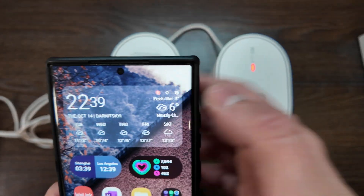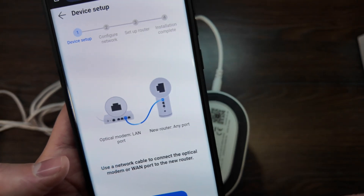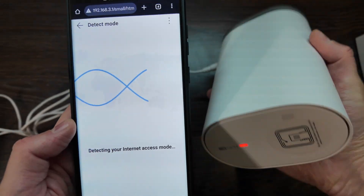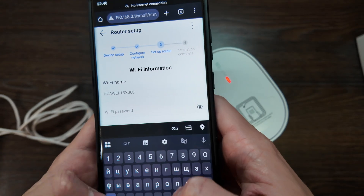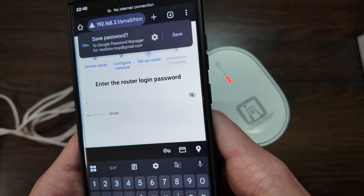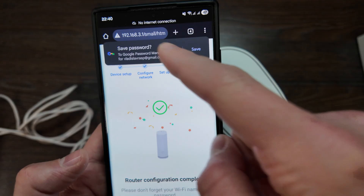Using the web address on my phone to complete setup. I'm connected — agree, allow automatic updates, get started. Selecting optical modem as a new router, connecting via network cable, detecting internet access mode. Choosing the recommended settings, creating a Wi-Fi name and a simple password. Setting the router login password to admin, and keeping the backup network enabled for devices that don't support Wi-Fi 6.